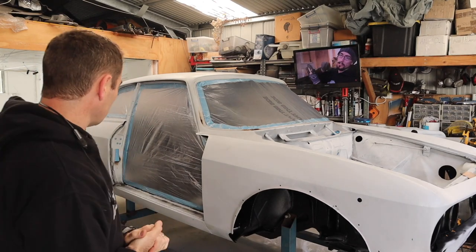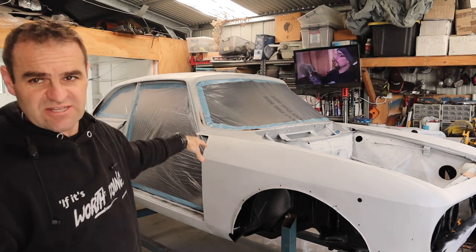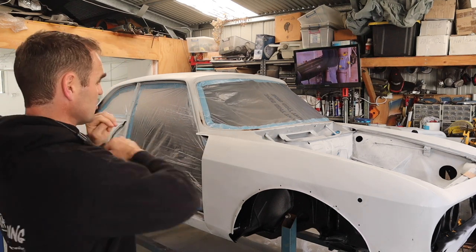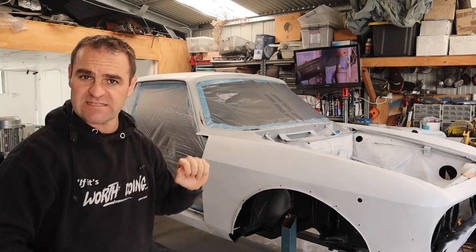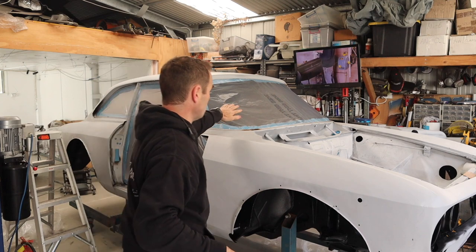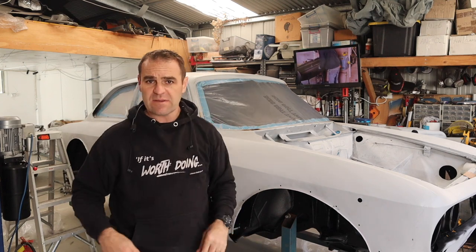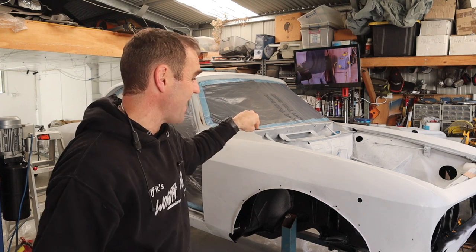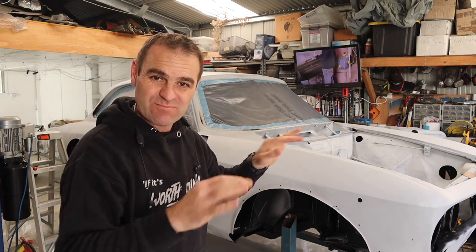We are now masked up. Just did it the quick way — masking around the edge from the inside, then putting plastic over and trimming around with a razor blade. Everything's all nicely masked up, so we can start moving back into the engine bay and seeing what we can do about getting everything nice and smooth and ready for some body filler.